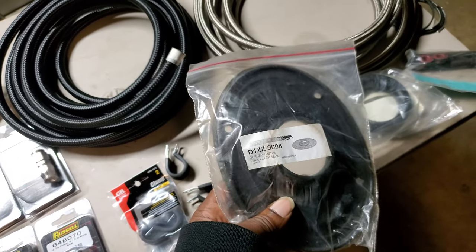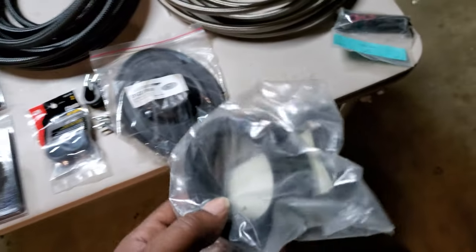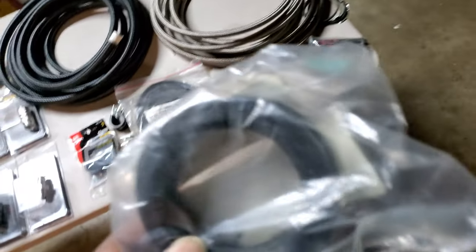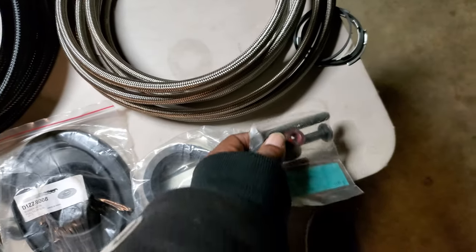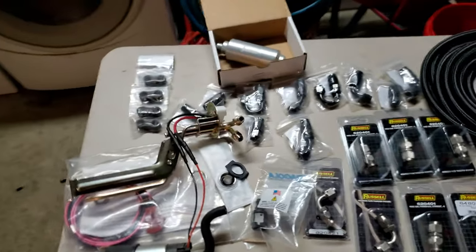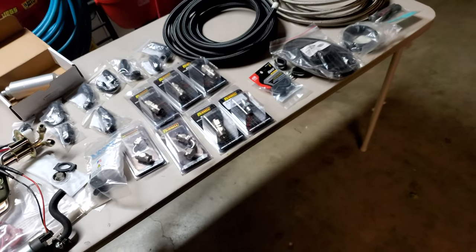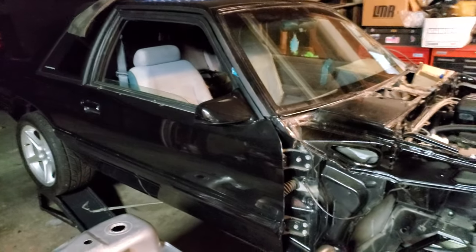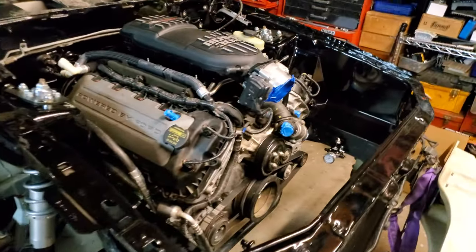If you're changing out your fuel tank you also want to change the filler neck to body seal - this one I have up here is actually the wrong one, just for demonstration. You want to change the filler neck o-ring as well. And if you can, get new bolts for the fuel tank because those bolts always get crusty. Even on this '92, which is the most recent fox body I've worked with, a lot of the rubber is still intact and in good condition - amazing compared to the four-eyes I'm used to.